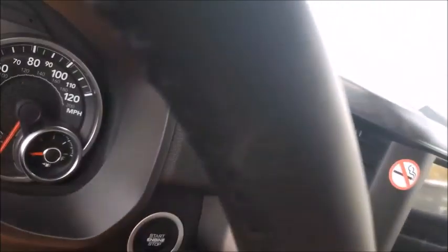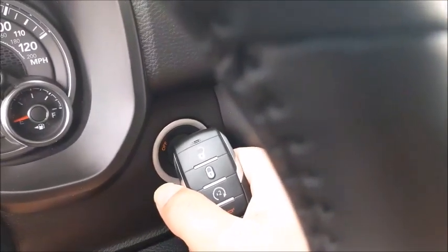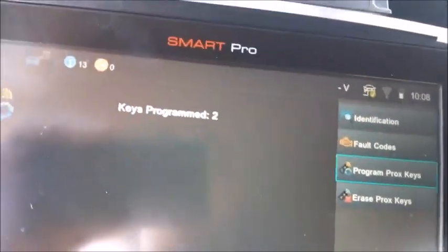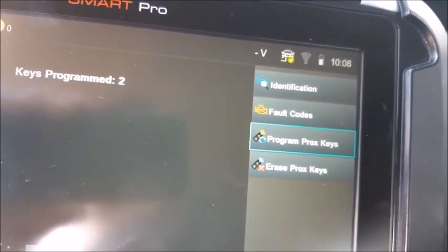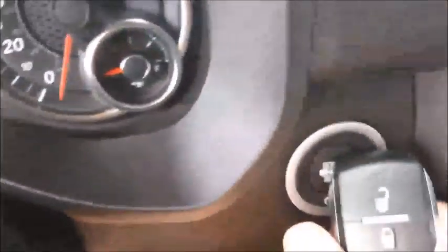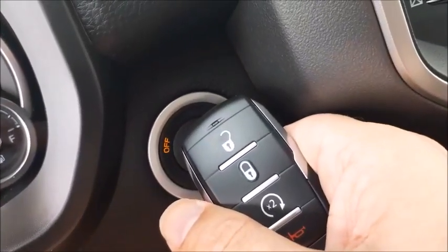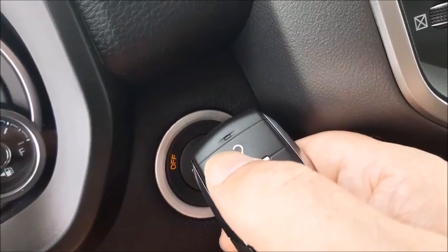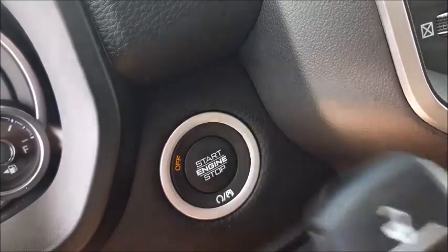Press unlock and the key will store. Now if you press the button and you don't hold it down, or if you press anything else on the RKE first and then press the button and you get rapid flashes of the LED, it's not going to program. You have to back out, go into fault codes, clear the fault codes, and start over — sometimes several times. The key is you need to press the button down that one time only, hold it down, and wait for the light to flash five times, not rapidly.